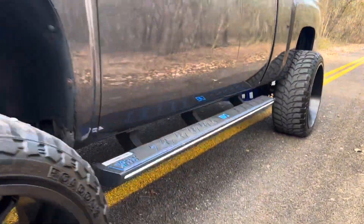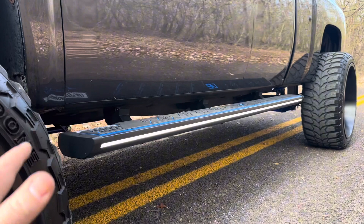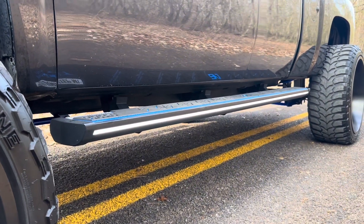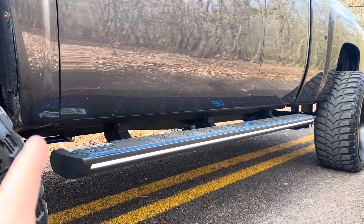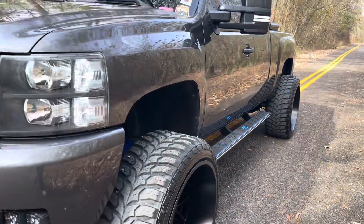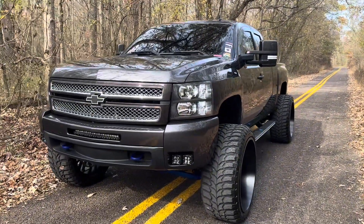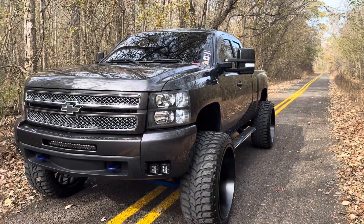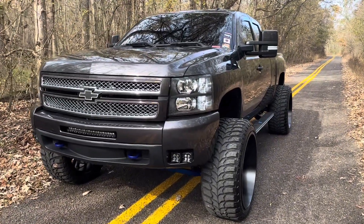It's a rock light function - when these are on you can flip that switch and the white light will come on and stay on. It cancels out the turn signal and just overrides everything, so if you leave it on going down the road your turn signal will not work. It gives you the option to leave it on if you're parked somewhere. I don't recommend tying into your rock lights because if you're going down the road with your rock lights on you obviously want those flashing for your turn signal, so I just run to a different switch which they provide if you pick that option.